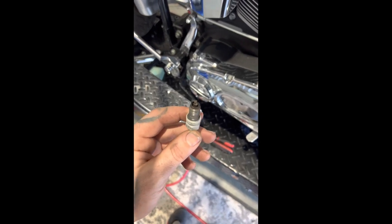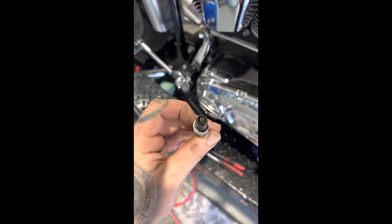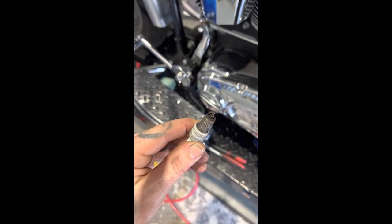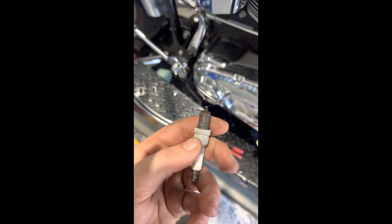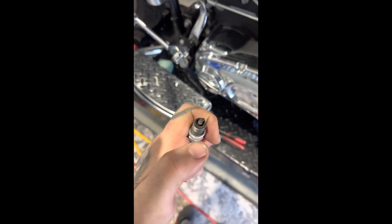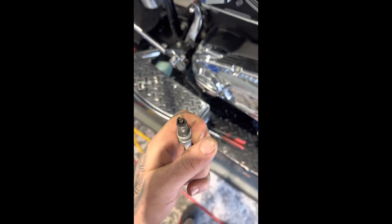The behavior is going to be a little bit different. The front — not bad. You can see on the actual earth strap there's a fine line there which is going to indicate our timing. We really want to see it on the actual bend on the rear, which we're a bit on top of. But anyway, we've just got to look for the heat, the amount of heat going through the plug, how it's running at idle, if the porcelain's got any fragmentation from detonation — there are just ways you can read plugs. We'll be putting new ones in, give it a run and see what it does.